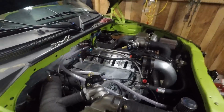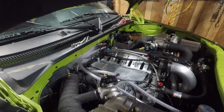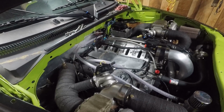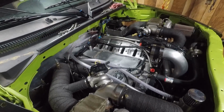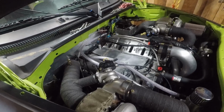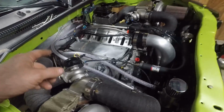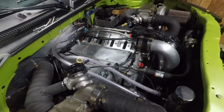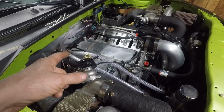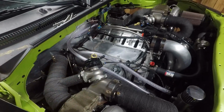If you don't follow me on Facebook or some of the other platforms, you probably didn't see the videos that I uploaded of why there's no intake on this engine. What happened is I got it mostly wired to where the thing will run and start, and I was doing my preliminary checks, going through the fuel system, making sure there were no leaks. I came up here to the fuel rail, and the injector for, let me see what cylinder it was. I want to say it was cylinder 6 was leaking, which would be the third one back on this side. It was leaking around the top O-ring of the injector rail.